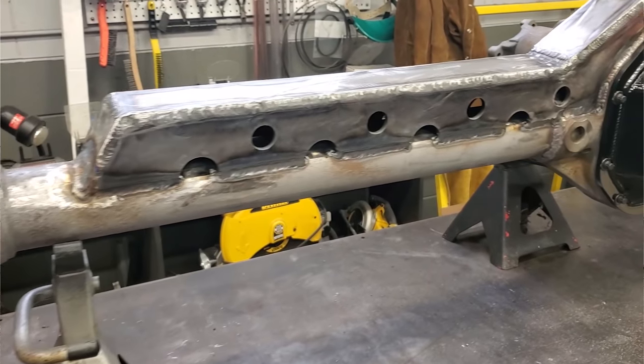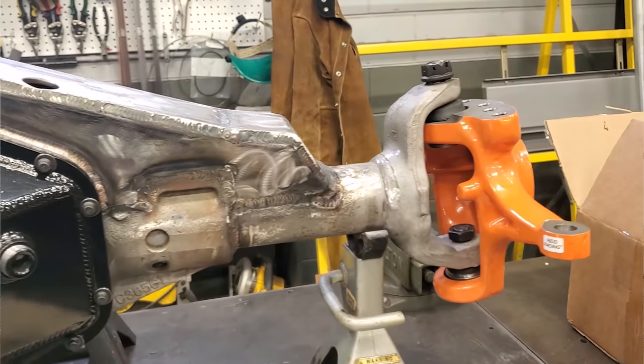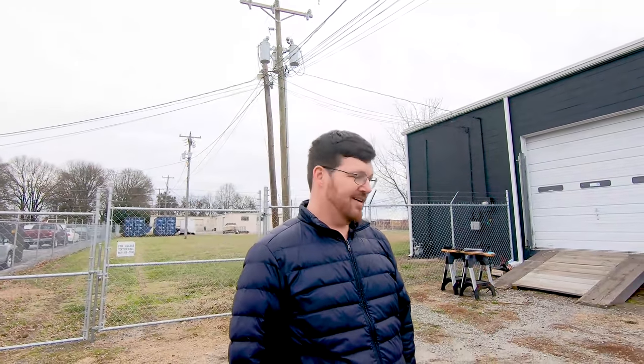The solution is a 1978 high-pinion Ford Dana 44, and I've been building it and posting a lot about the progress. There are a handful of SAS Sequoias out there — probably five or six — and the majority are on one-tons or Dana 44s but on leaf springs. I'm going to three-link this one on 14-inch coils, which will make it unique. Stay tuned because after he gets this done, we're definitely going to come back and take a look at it.